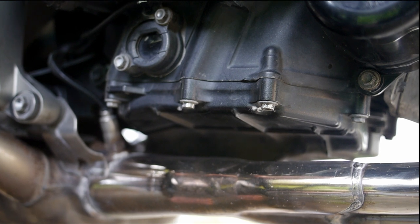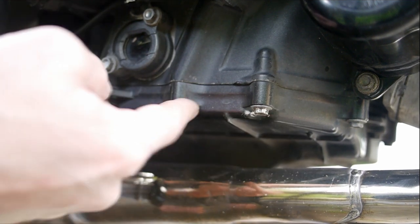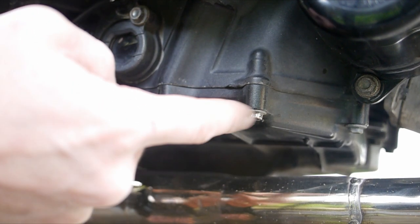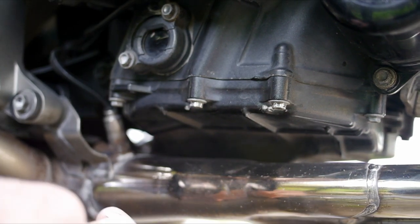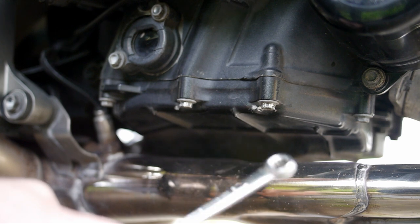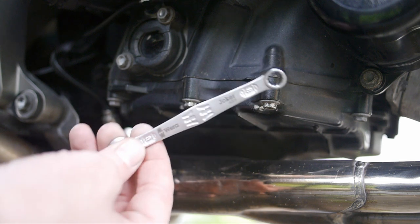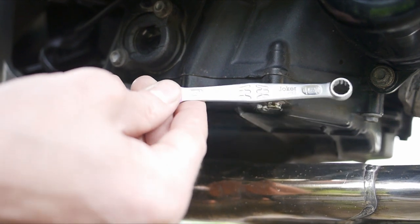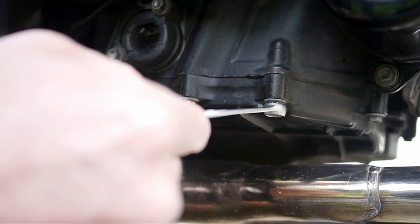Right then, fast forward to the next day. I spent the afternoon yesterday on the internet trying to find some nut extracting tools to remove these things - to no avail. The only things I could find were apparently made of the same metal as these bolts and broke after one go. I then spent this morning charging around various hardware stores - also found nothing. But I did stumble upon a bit of an idea. I've caused this problem because of the combination of the toffee soft bolts on this Honda CB1000R and a cheap nasty eight millimeter spanner. So I thought it was time to finally get myself a Wera joker spanner - cost me £8.50, well technically it cost my wife £8.50 because she treated me. I jumped out of the car, came straight over here, plugged this on - it was already a better fit, but it still rounded it off.